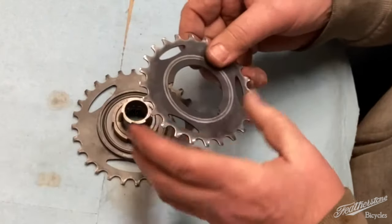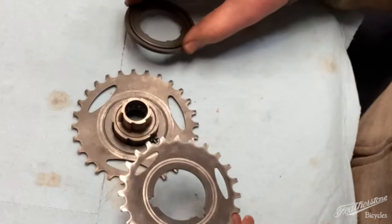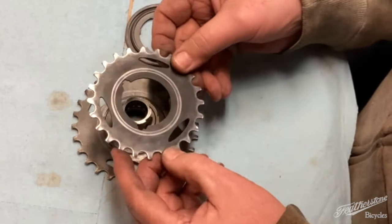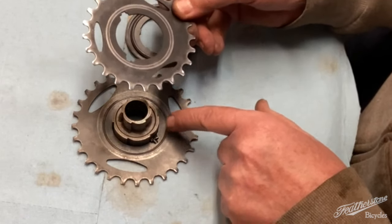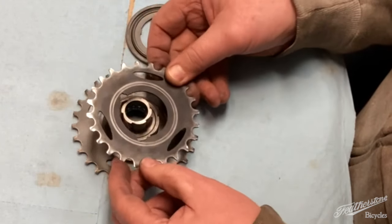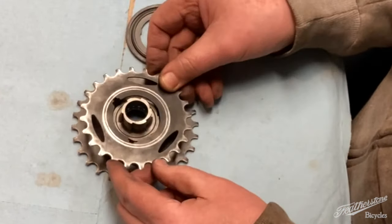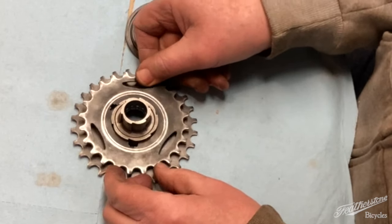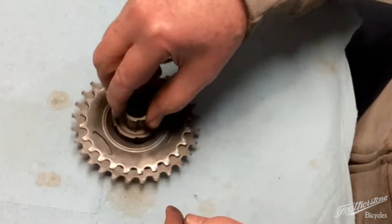There's one. There's two. Now you want to probably put a little drop of Phil's Tenacious Oil or any kind of sticky heavyweight oil on those two pawls. The next part is this spacer — the spacers have the same profile as the pawl ring, it can't go the other way, it doesn't fit, so it's got to go this way. Then the next sprocket. I don't know if this matters, but I'm putting them alternating. So there are only two pawls on each one, and I'm going to put them opposite — they're about 180 degrees. These are about 180 degrees from the other ones.